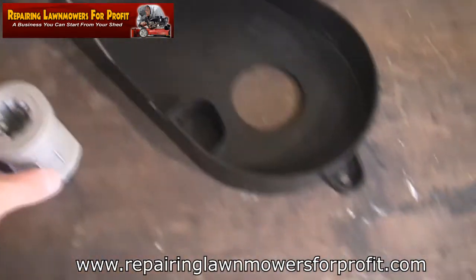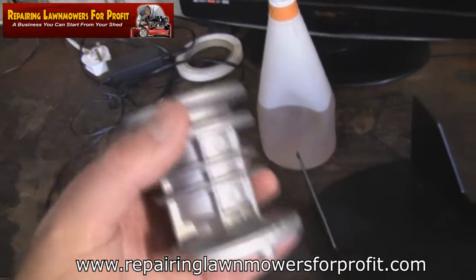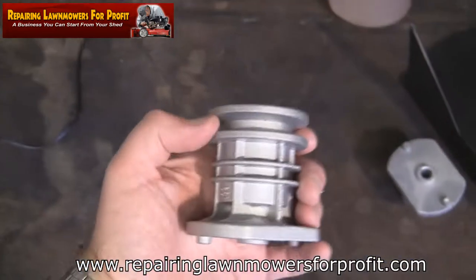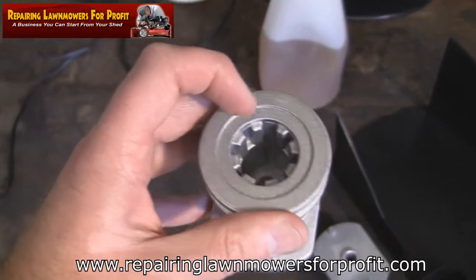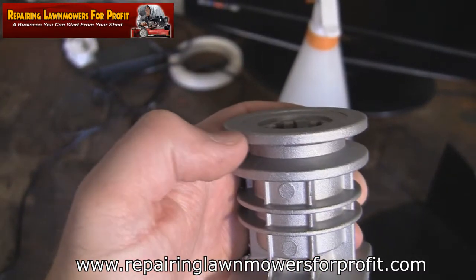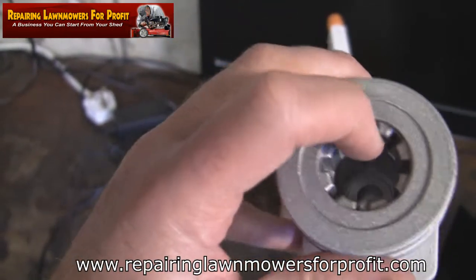As if by magic, the two parts are here. I hate buying new parts - I don't think I've ever really done it before - but on this occasion, because it's for myself, I've bought them. About eight pounds each. This is the blade adapter. Keep an eye on this: if you've got a mower without a drive that you push along, this is the blade adapter you need for the HP 470. If you've got the drive version like mine - a Mountfield SP 470 - you need this one where the belt goes around. The keyway on the crankshaft needs to slide down here; there are different gaps and it slides right to the bottom. Put the belt half on and as you turn it, it works its way back on, sliding up to the top with the keyway on the correct slot.